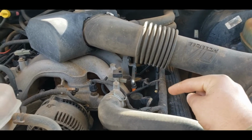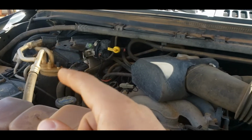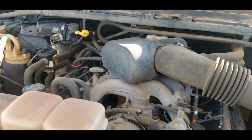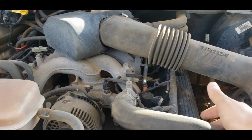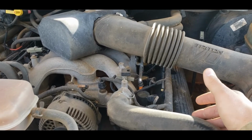On this side, it would be difficult. On that side, you'd have to take out all the AC evaporator stuff in order to get in there and really see what you're doing and be square when you're tapping new threads for the helicoil and whatever. But if you do, it's not the end of the world. That's the big thing. Yeah, it's going to cost you money. Yeah, you're not going to be able to drive your vehicle, but it's not like you've completely destroyed your engine.